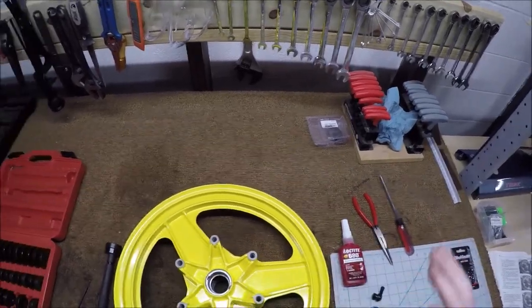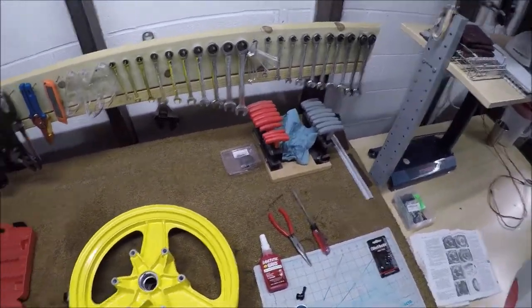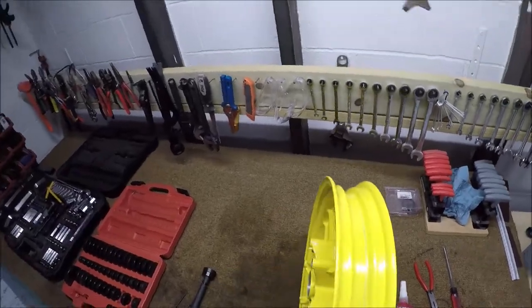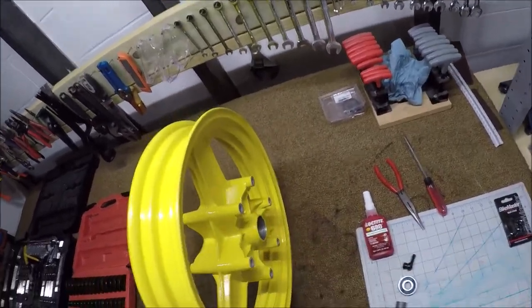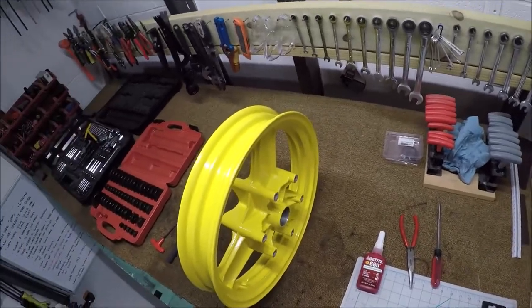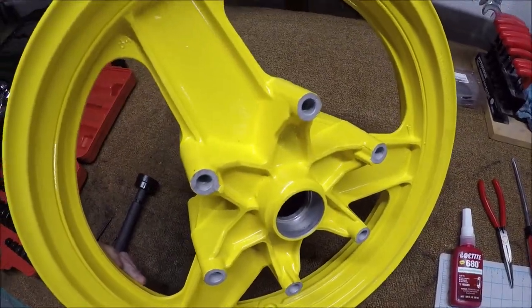I will be trying that out — I won't know if it works until I ride the bike, so I can't give you any indication yet. The last thing: I was going to put some 90-degree valve stems on it. If the chain is on this side, I'd want it off to the right — a nice 90-degree stem. But with the wheel shape on this one, the 90-degree isn't going to work because of how deep that recess is.